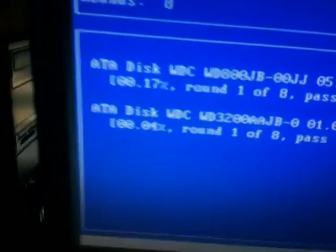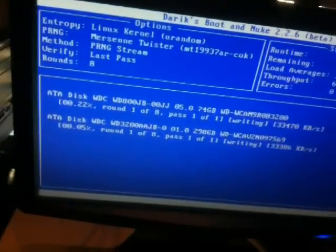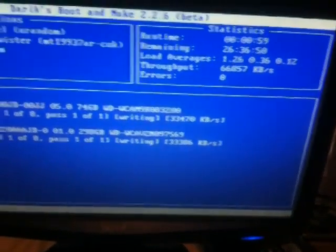So, this is my method of debanning a drive. Since these drives are going to somebody, I thought I'd take the opportunity to show you guys probably the most secure method of erasing drives with DBAN. Obviously, the most secure method you can use is a secure erase, since that hits the chips on the boards themselves and the drives. But this method is quite a bit easier and almost just as effective.